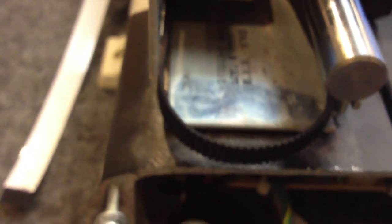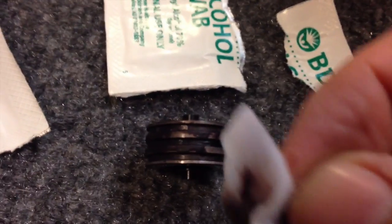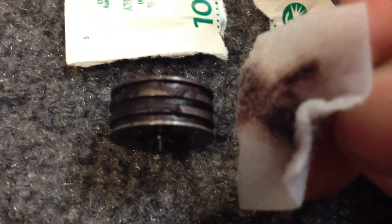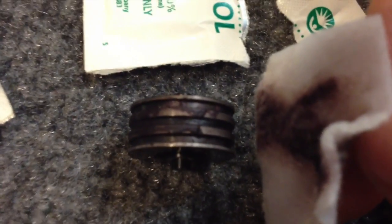I found my alcohol — let's clean off that tensioner roller, which is really grimy. This is probably why my last belt didn't last very long — I may not have cleaned this off in the first place. It's got this oily gunk on there that probably penetrated and degraded the previous belt.